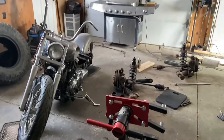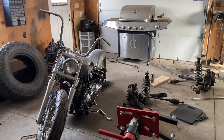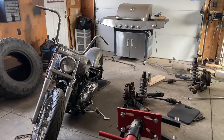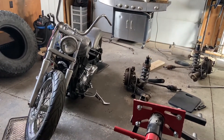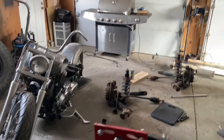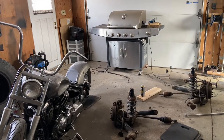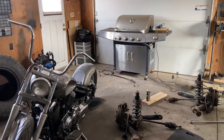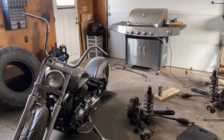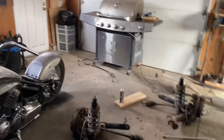I need to get the new daily in here and look at the front end, because the steering on these '03 Cummins is absolutely garbage. I'm very suspect that the steering box has called it quits. We're going to go through the front end starting from the ball joints and tie rods and work inward from there, leaving the steering box for last — but I'm almost positive that's what it is.